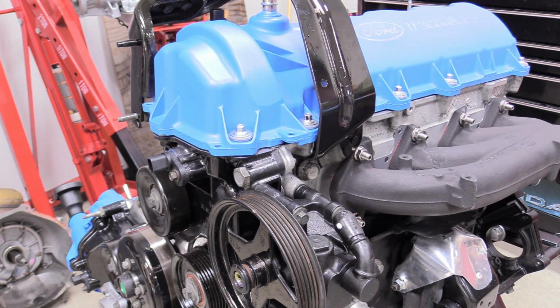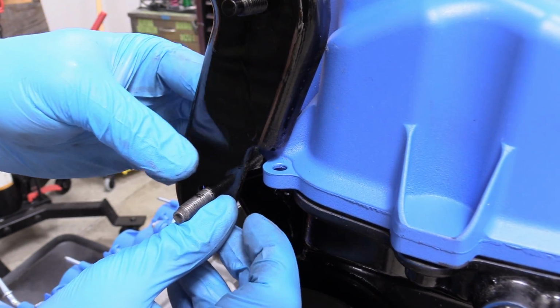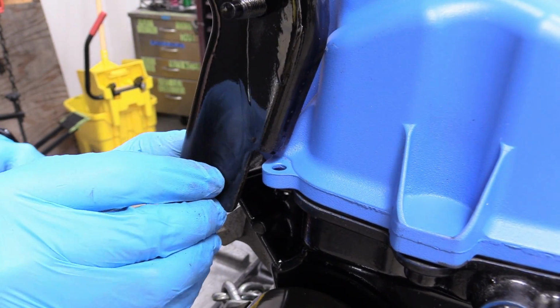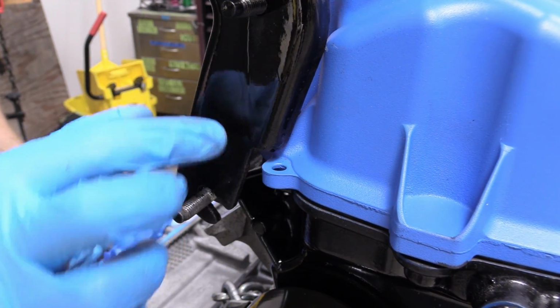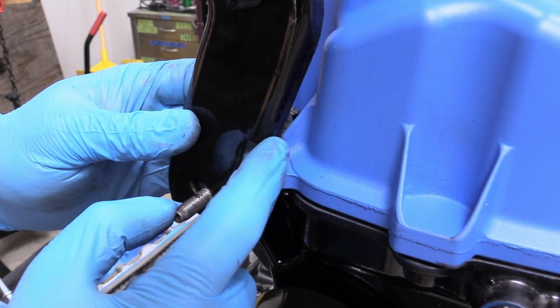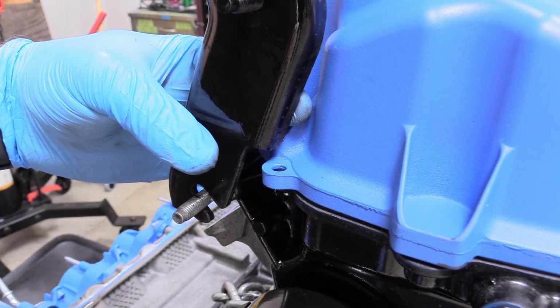It's probably good. And I've noticed just a small interaction with the valve cover right here and it. So if you're really worried about that, you can clearance it like I think I'm going to do. So I'm going to cut that off. That'll be off screen. It's kind of a custom thing. It only pertains to this valve cover, as I don't want it bumping against there, making all kinds of noise, and you know, ruining my new valve cover.